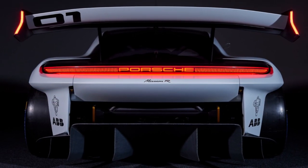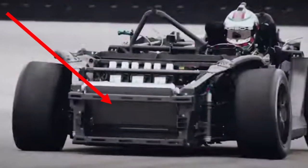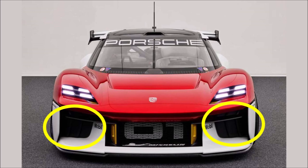This is also very important for customer racing. Porsche uses one large radiator in front with a large air intake in the center and a center outlet. Because hot air exits from here, the roof scoop for driver cooling doesn't make too much sense there. The large side intakes at the front have active elements, but there is no function for these intakes.